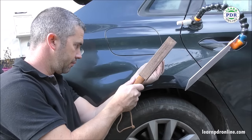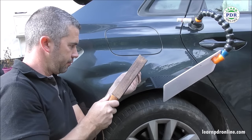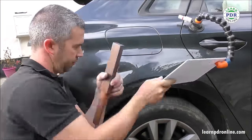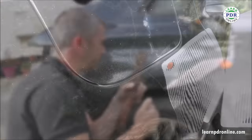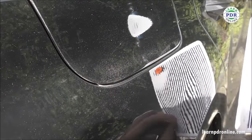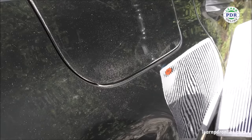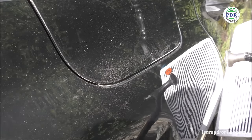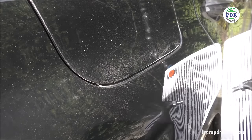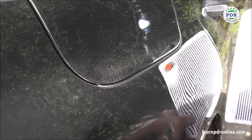Before I tackle that crown, I'm just going to take out the high spots I created during that last pushing process with my tool tip from the inside. I'm using a root beer tap down, which is great for giving me some precision. It's also lighter weight, and so is the paddle I'm using to tap it down with - it's got a leather pad on the inside so it gives me a really nice soft damper. Now as I assess this crown, I can see where those lines pinch together. I'm going to gently tap down that crown using my blending hammer - it's just a bit quicker for me than holding a tap down and a hammer in two separate hands.